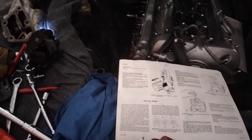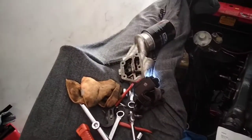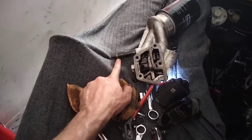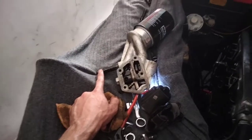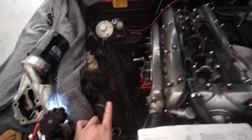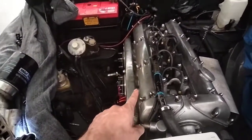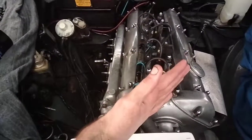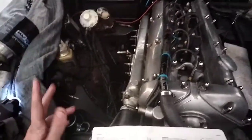Which is bloody worrying, isn't it? The first thing I thought was maybe it would be the oil pressure sender going out, which is located just on top of the housing here — this has got a manual gauge fitting in there at the moment. To test that, I took the wire which goes up to your electric gauge in the dash and just sent that to ground. That will check the gauge itself is functioning. When it goes to ground it will go to the maximum reading it can provide, which is 60 psi in this car. And it did that, no issues. So we can rule that out.